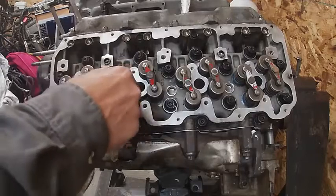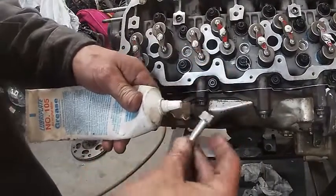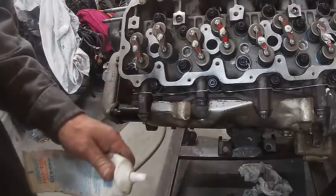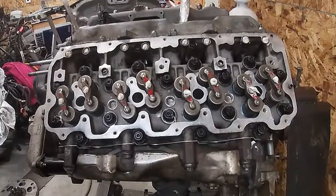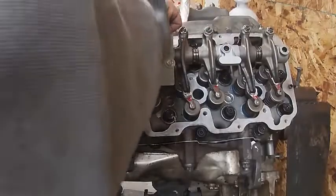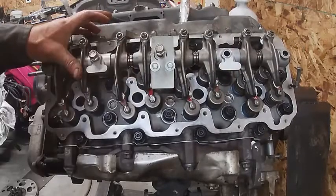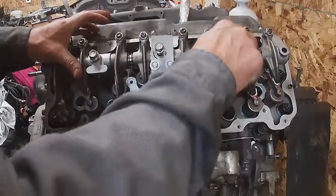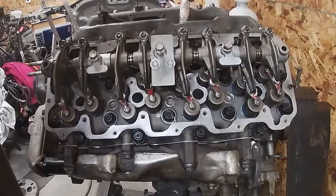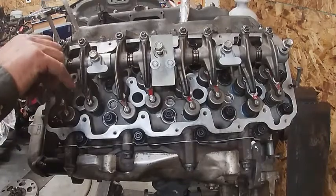Install the driver's side — I'm going to work up this way. I'm also going to put the bolts in and do those threads. This is going to do the head. Go ahead and install the rocker shaft. The biggest thing again, like I did on the other side, I'm going to make sure the push tubes line up. Start in the middle. This one and this one have dowels on them — you want to make sure those are started correctly before you get too carried away. Push that rocker shaft back, push down.